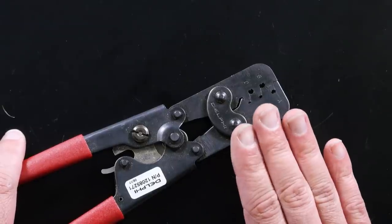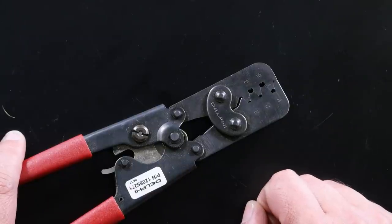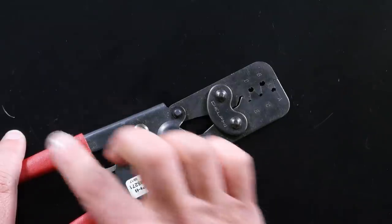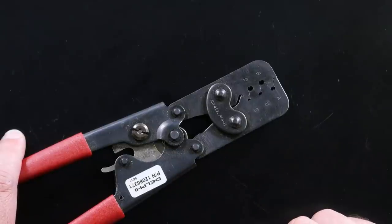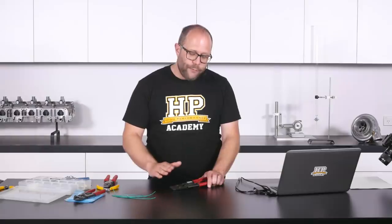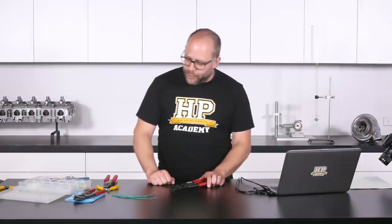The tool we are going to use is what I call my open barrel splice tool — it's actually just another general purpose crimp tool but with much thicker dies. That gives it the rigidity it needs, along with a leverage mechanism which gives you the mechanical advantage to really easily perform that splice join. Those thicker jaws ensure all the pressure you're applying goes into the splice and not absorbed by the rest of the tool. This is the Sargent Tools CT3137 — I'll put the detail up in the forum post as well, and we do also have it in the wiring fundamentals post.